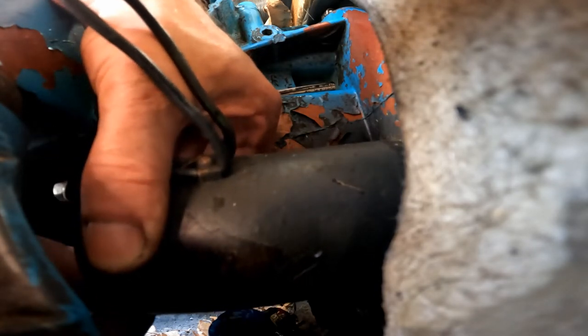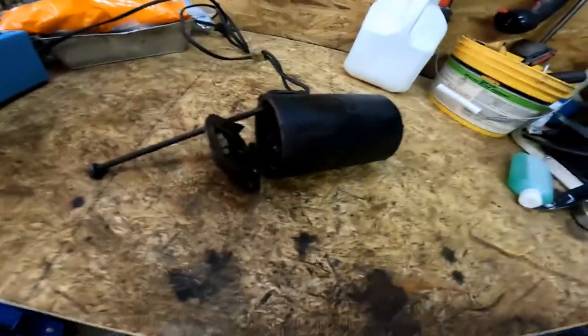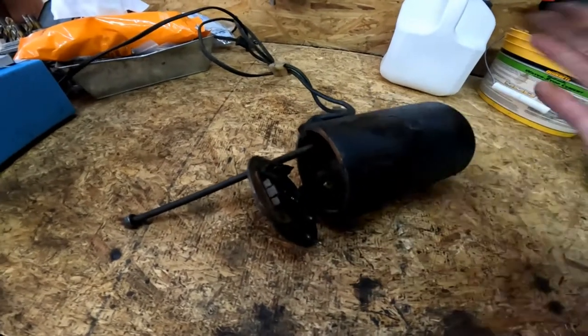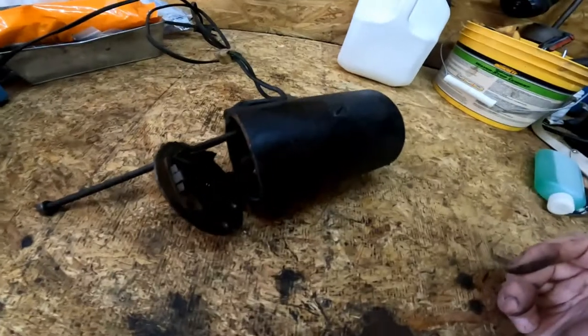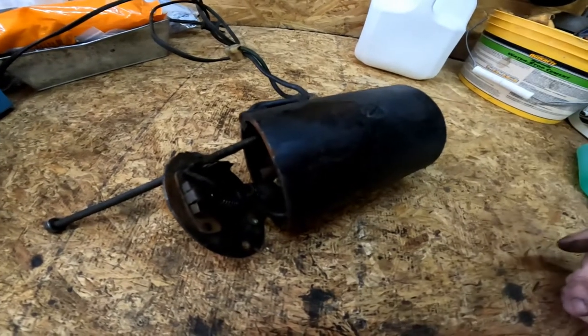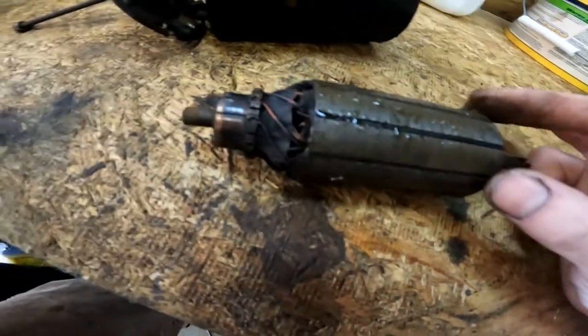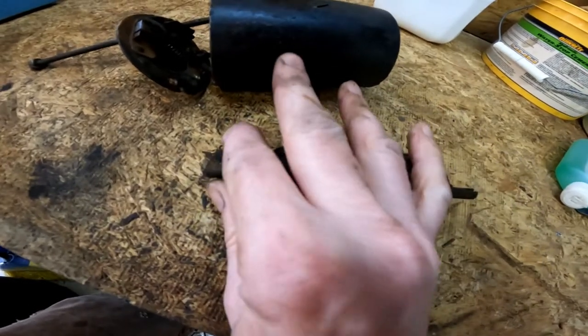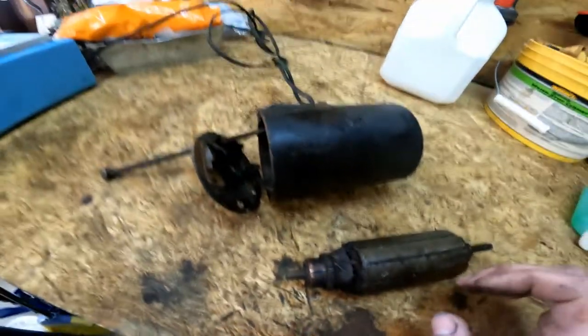You just have to take some of the weight of the motor off of it and slip it out. This motor has given me problems for the last two years since I've had the boat. It's an electric motor that's low in the bilge, so if you're not careful and forget to take the drain plug out and it rains hard, the bilge fills up and this motor gets waterlogged. After years of that happening it's just thrashed. I've taken this motor apart before, cleaned all the electrical connections, serviced it, and it works a little better — but it's seventy dollars for a new one.